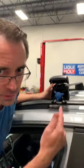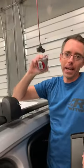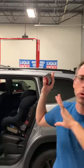You've got to make sure they're positioned right first, which I haven't actually verified. Factory instructions say you should measure 21.65 inches from the front of the roof rail to the center of the front bar, and 29 inches from the front rail to the rear one. Having the correct measurements means you have the proper load on your roof — now I'm ready to carry so many loads.